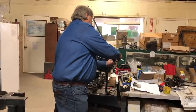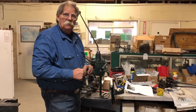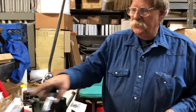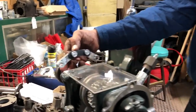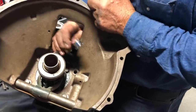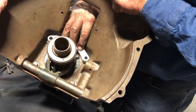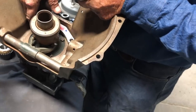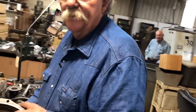Once the hole is cut, you pull your oil plug out — and this is an extension with an inner dipstick and a cap. Number one, you can check the oil in your transmission easily at any time, or you can pull the cap and simply fill your transmission from the passenger side. The biggest ruination of Model A transmissions is people letting them get low on oil. One of the four places the Model A significantly loses oil is every time you shift into first or third gear — it pushes your shift rail out through a hole in the bell housing. We've made a seal that attaches using the top two transmission bolts and simply stops that leak — for a current price of $45.